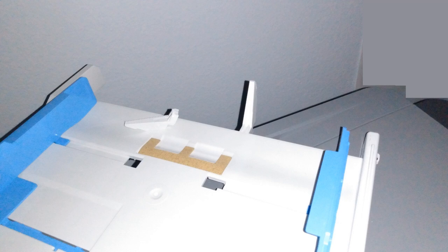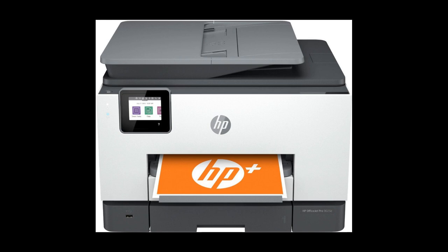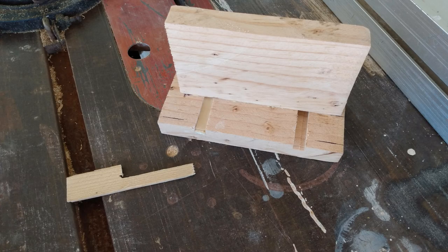So I decided to try and reattach, plus strengthen, the tooth. I did both teeth because I figured either one could snap off if someone pulls the tray out at anything other than a manufacturer-approved angle. I decided to apply steel wire and JB weld to the weak areas of the plastic where the teeth joined the tray. First, I measured the tooth locations and built a brace out of pine wood.